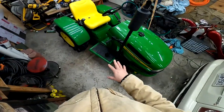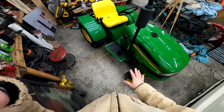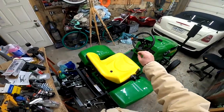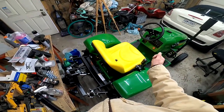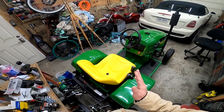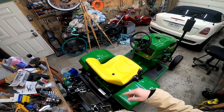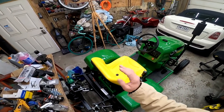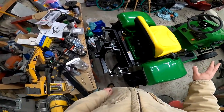Alright, so today I got a couple things I'm gonna work on here. Let me describe my issues. First, the speedometer was only showing 1 mile an hour. So I recalibrated it for this. I think it has a decimal point on here and it didn't in the instructions. So I'm assuming the decimal point on here doesn't count, because it was showing 1 mile an hour when I was going probably like 15 or more. So I removed the decimal point and ignored it when I put it in, and we'll try that again. So that should be good. Besides that,